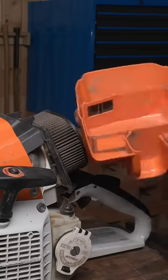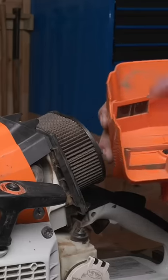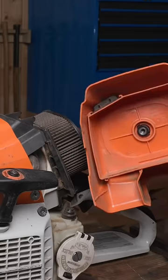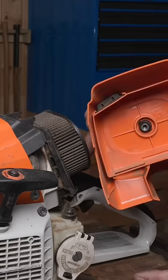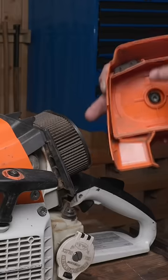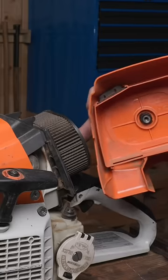This 461 has it right here. If you'll see right there on the intake side, there's a black removable plug. That plug is designed to be used in extreme cold weather if your carburetor starts icing up. What it does is it pulls extra air that's been warmed from the top of the cylinder head into the carburetor and prevents icing.